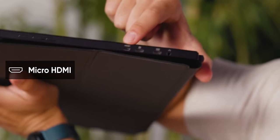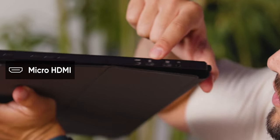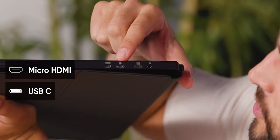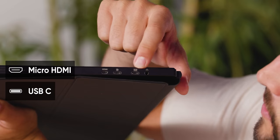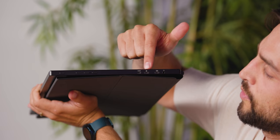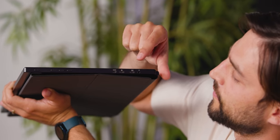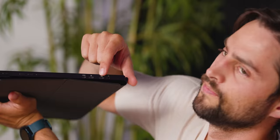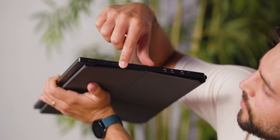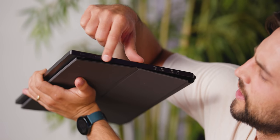On this side we have the aforementioned micro HDMI port. We have a USB Type-C form factor DisplayPort — that's DisplayPort alt mode on USB Type-C. Then you have another Type-C that does not have DisplayPort but does support just charging. The DisplayPort one has charging and DisplayPort; this other one is just charging. So you can charge this while you're running on HDMI, which doesn't have power delivery. Then you've got a headphone jack, the power button, volume rockers, and other OSD controls, which feel reasonably tactile.